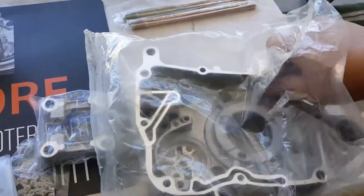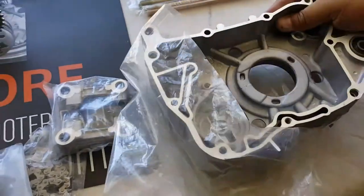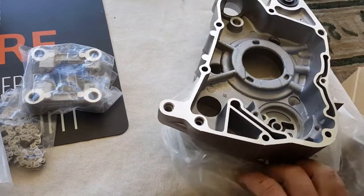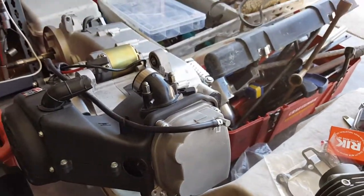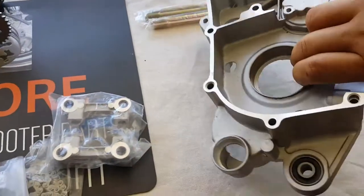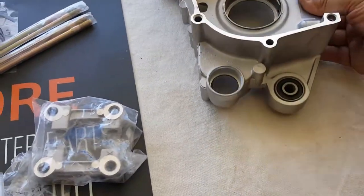We're going to start with the smaller one — the left side of the crankcase — and that's where a high-flow oil pump will sit right in there. This is a B-block engine, meaning it's going to be a 57mm spacing, not your stock 54mm spacing. Even though they're the same length long case, what makes them 54mm is the distance between the two points where the studs are laid out. I'll show you the difference between the studs in just a little bit.